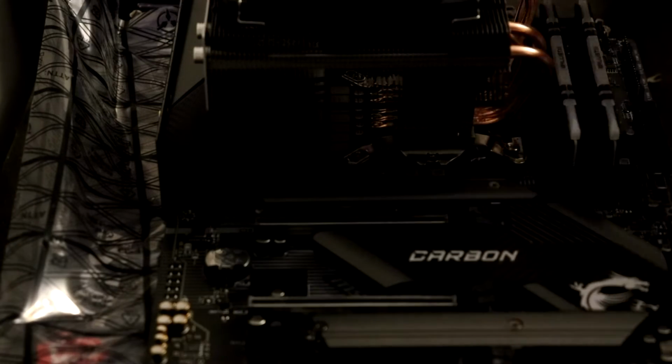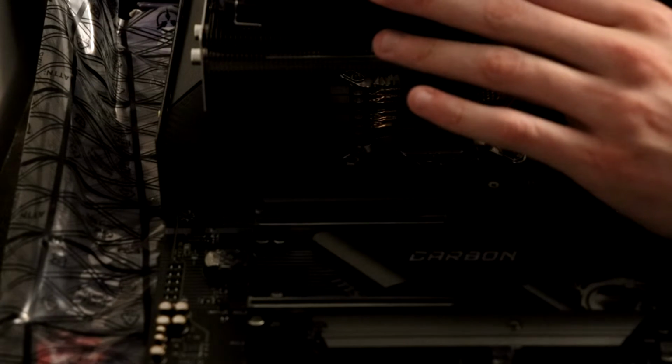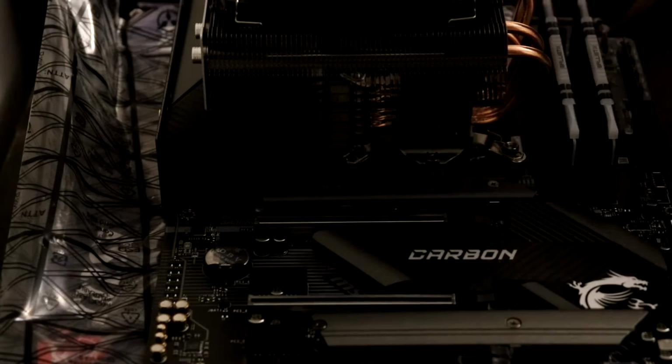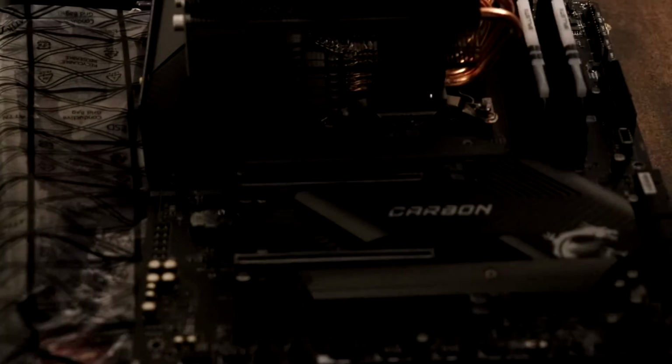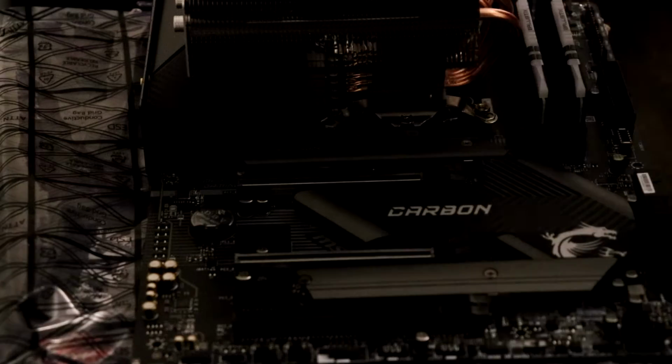Also, lining up the bolts with where it should mount on the brackets was a little difficult, because there's different spacing that you can use. I would recommend mounting the brackets first, maybe, and then attaching the CPU unit to those brackets, and that might work a little easier than the way that I chose to do it, but you can get there using the provided equipment that is within the motherboard box and the CPU fan box.